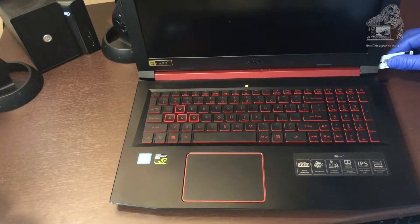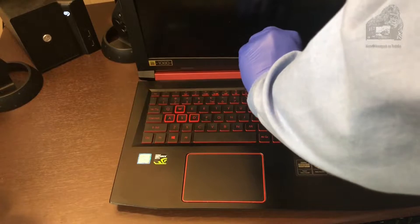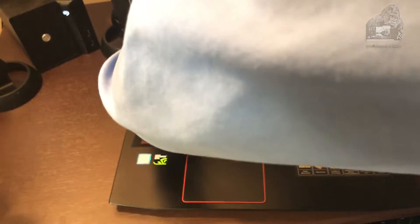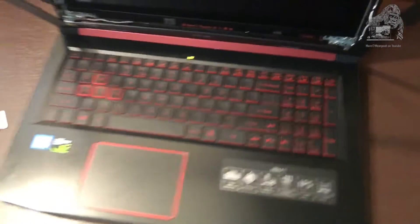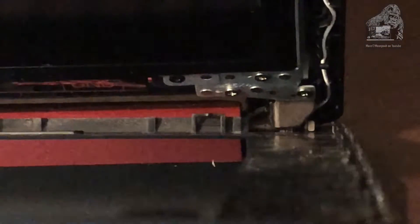We're almost done. We're going to start here and work our way over to the left side, putting the prying tool on the inside and working from right to left. This was a little tough and at times it felt like it was going to snap in half, but they'll come off — just take your time. Once you're done pulling the bezel free it will hang and look like this. You can actually see the clasps in there, and those are what you were pulling away from. Just go ahead and lift it up and set it off to the side.